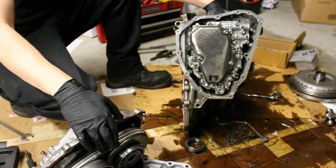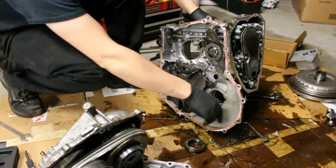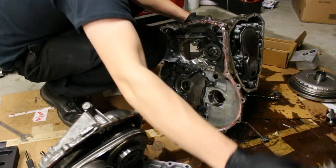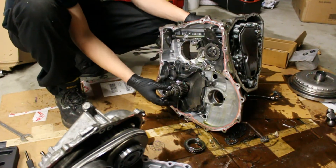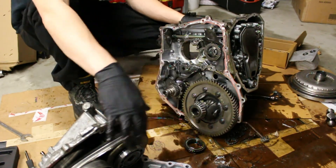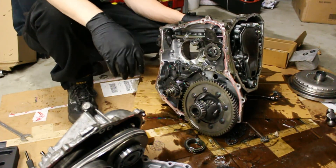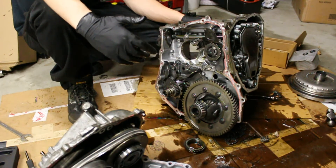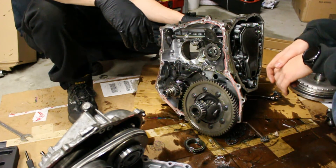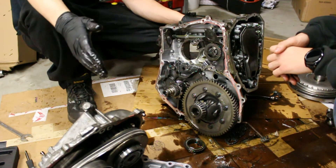If you have any questions, comment below and I'll try to answer them or make another video. This is your drive gear, which comes out here through a sprocket that turns your differential, which sits like that. So your gear ratio is determined by the pulleys, which turns the diff, which turns your wheels. It's very simple. The complexity is more in the valve passageways and how everything's programmed — but mechanically, it's simple.